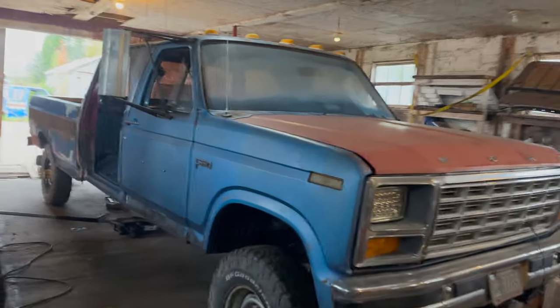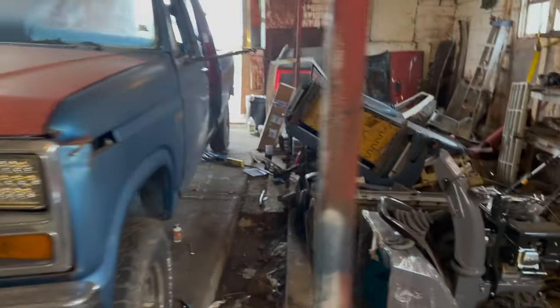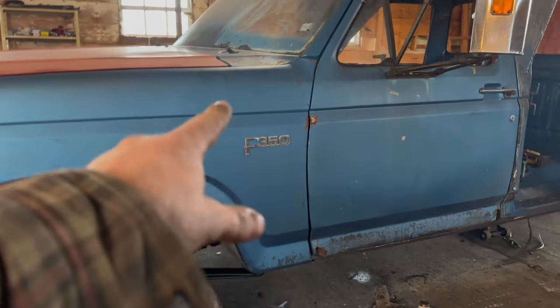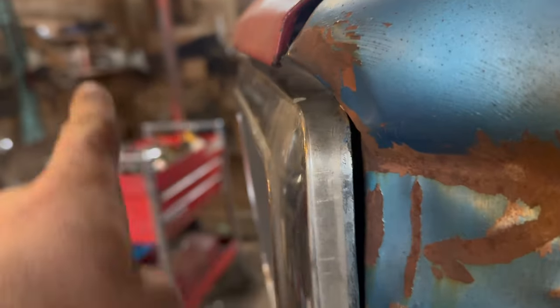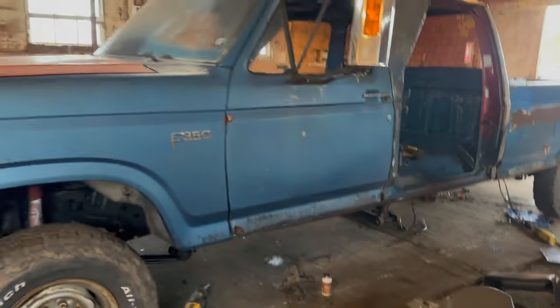First door on the Mega Cab — not perfect, but we got her pretty darn good. It still needs some adjustment but opens and closes pretty good. Got the driver door on. This part of the fender needs to go up, and it proved our suspicion that this side is inside a little too much based off our gap. A lot of it is this guy's too far back. The rad support is too far back on one side and just about right on the other — so this whole corner needs to come out and basically twist over to the side. We'll save all the adjusting for later.